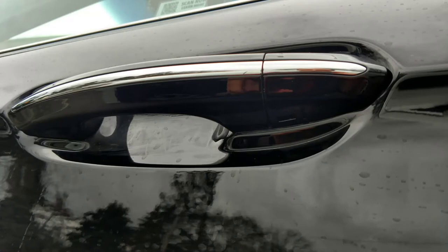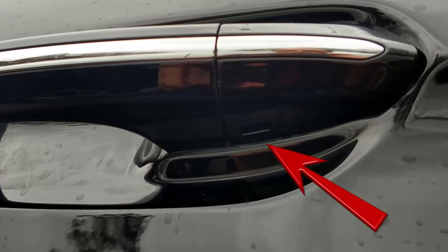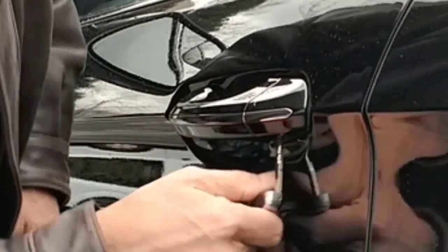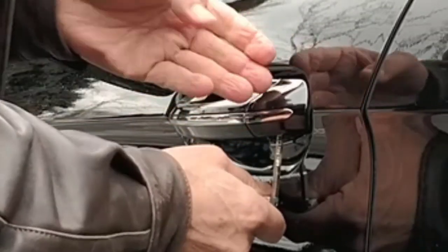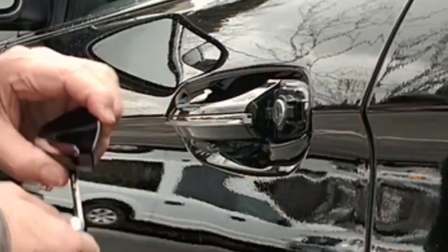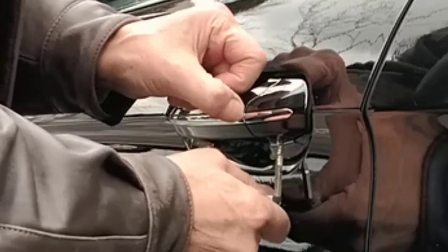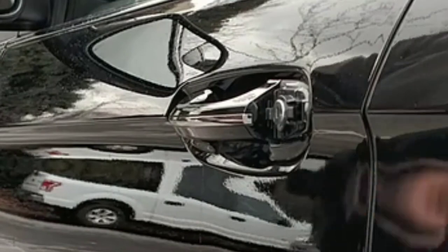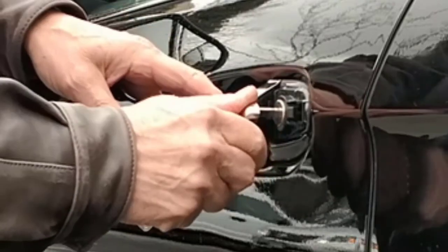In the Edge, the keyhole is hidden by a cap at the rear of the driver's door handle. To remove the cap, look for the slot on the bottom of the cover as shown. Insert the key blade into the slot and press up — the cap is now free to move. While maintaining upward pressure, work the cover rearward a bit; it can then be pulled away. Yes, the effect is that of prying off a piece of your car, but it's okay and needs to be done. Once the lock cylinder is exposed, insert the key and turn and you're in.